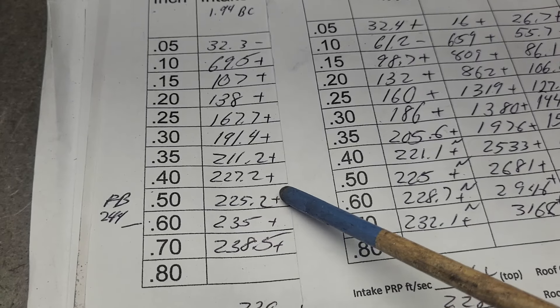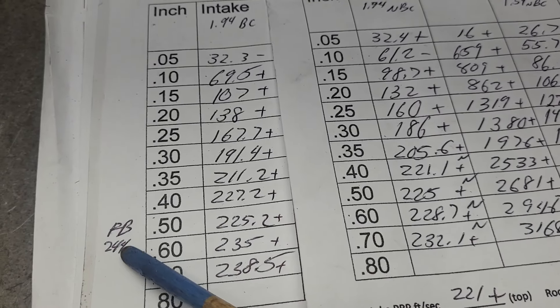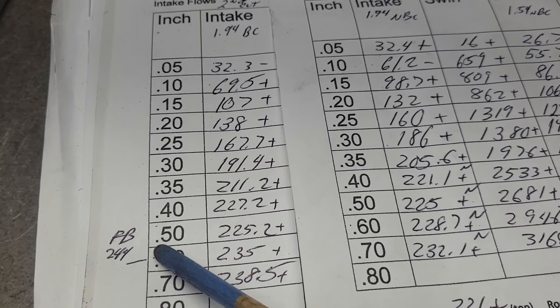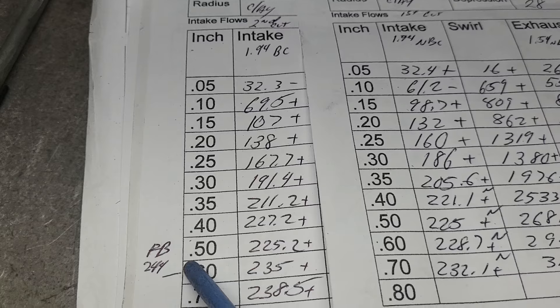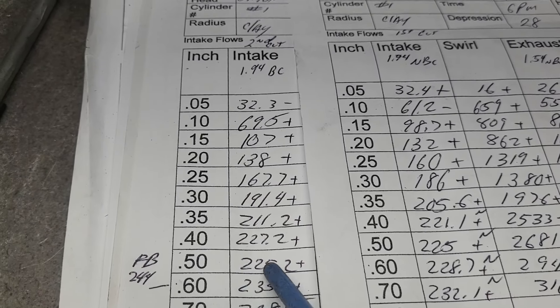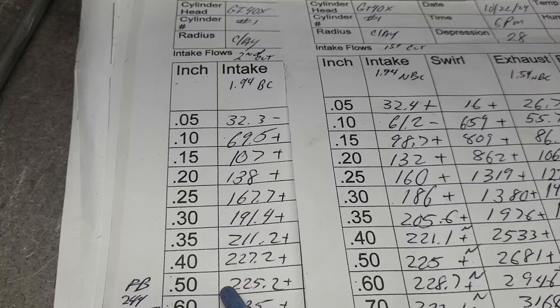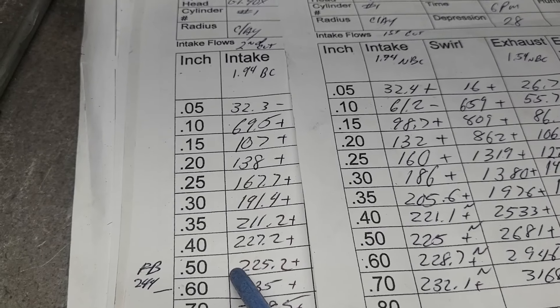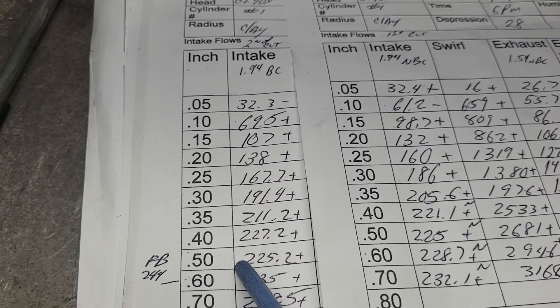While it was maxed out on the bench here at 235 CFM, I did some flow ball work and if you work on that short side there's 244 CFM available. That tells you where we need to concentrate our work. The short side is going to be ugly because it's so low, so you've got to work with what you got — unfortunately that's the original design on these heads.